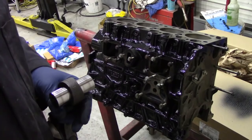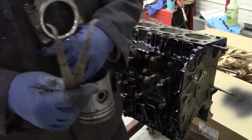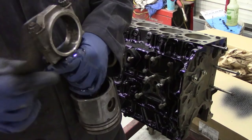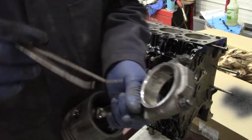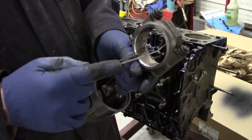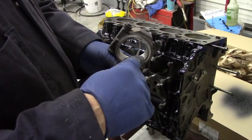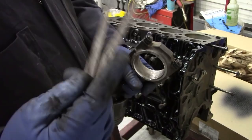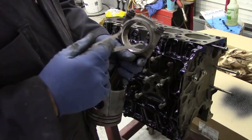This is the replacement rod, and these are a pair of internal calipers - a very old way of testing bores if you haven't got a micrometer. They won't give you a measurement but they'll give you a feel of what things are like. You open them out a little bit, set them at an angle, then pull them so they're in the middle - you'll feel they're absolutely touching both sides. Then try them on the split and it should be exactly the same. I know this rod is perfect.